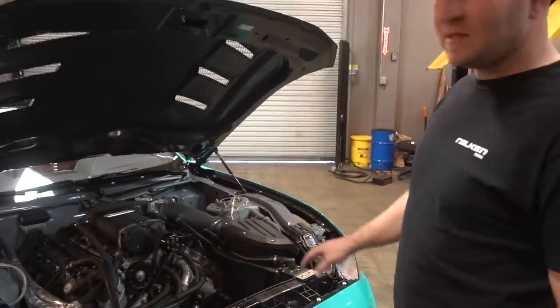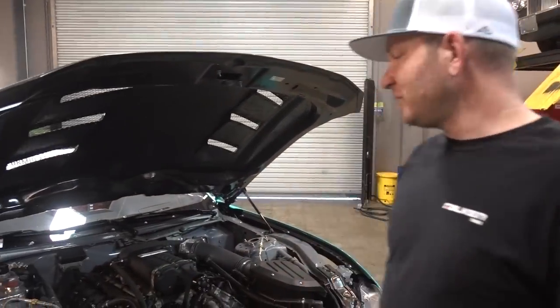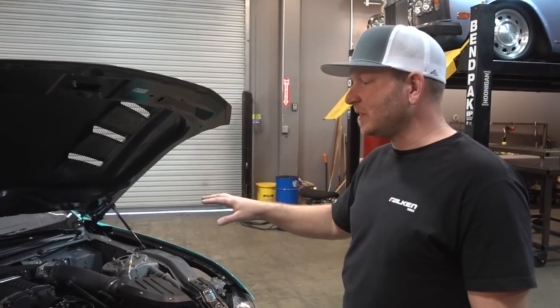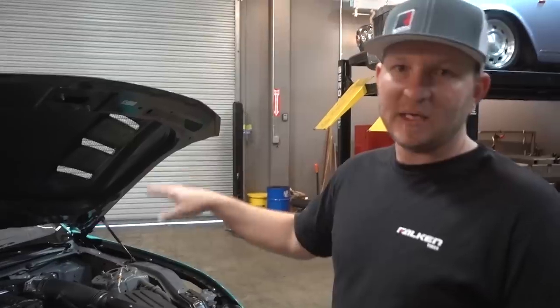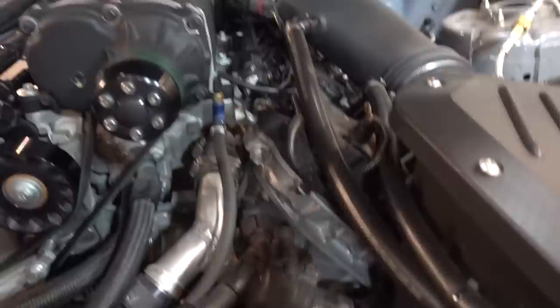What size are the injectors? Injector Dynamics 800TC full stainless, because I run Ignite ethanol. So we want to run all stainless everything on the fuel system, along with PTFE lines so that you don't have any expansion of rubber or anything like that.